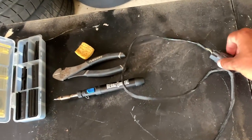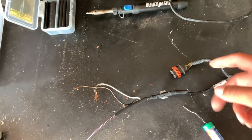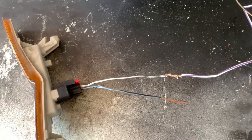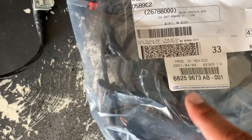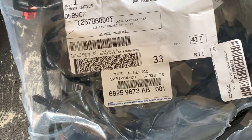The first thing laid out here is the pre-2015 wiring harness for the side markers and fog lights. Now, changing to the Hellcat front bumper, there are no fog lights anymore, so we don't have to worry about that — I'm not going to cut it, just going to leave it like that. This is what it normally looks like, and basically you need this plug to go into the LED side marker. I've already figured out how to wire it up, and this is the part number you need to pick up.